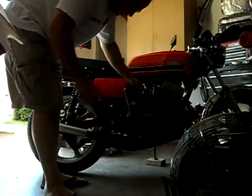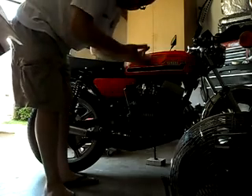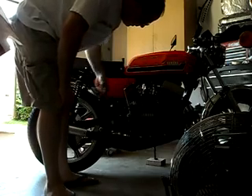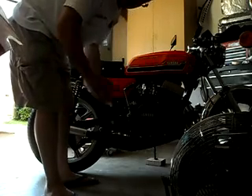270 main jets — I know it sounds rich — but the bike sounds good off idle, and it idles better than my... you know, it's crazy. Fourth clip on the needles, 27.5 pilot, running inline fuel filters, stock spark plugs, Boyesen reeds.